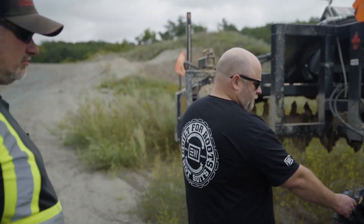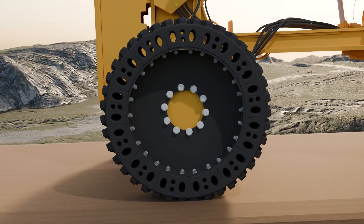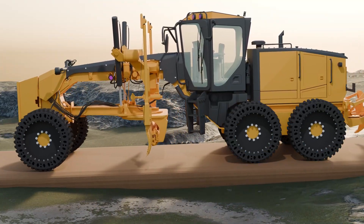Taking heat readings with the heat gun on the tires, what I saw was that the rear tires were colder than the front tires. Based on all the heat testing we've done in the past on different tire sizes and applications, that tells me the fronts are working harder than the rears. That's probably because the bouncing tire is moving a lot more, causing a lot more flex and kinetic energy within the tire. Those heat results — hotter in the front than in the rear — really confirm our theory.